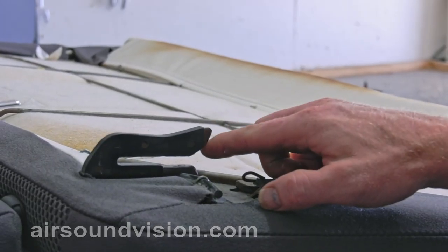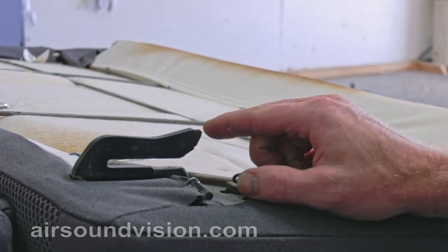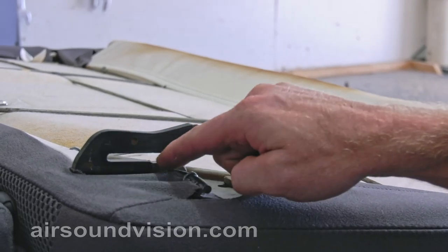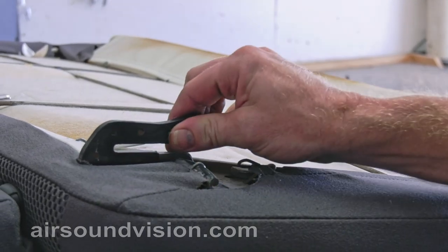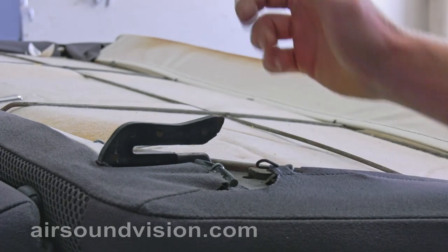Okay, here you can see we've cut this off now with the grinder and rounded the corners off, so that when we go to put the seat back in, the rear mounting rail on the back wall will slide in here easily. Once it's in place the normal range of operation is this area here, so it does not affect the seat at all. This needs to be done to both sides of the seat.